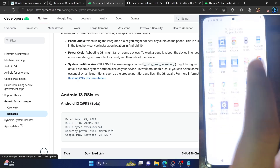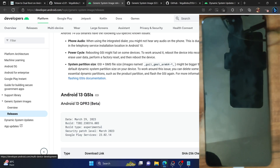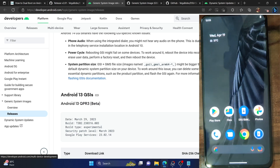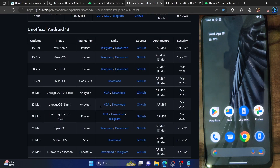This is the system with the latest Android 13. You can even install OTA updates directly from this section — there's no need to go through a separate route. So this is our second GSI ROM. If you want to go back to the stock ROM, just tap Restart and your phone will be back to the base ROM — in our case the Pixel ROM. Both ROMs have separate data partitions: files on the first ROM don't conflict with the second ROM. You can sign in with a different Google ID and have your own Google apps and Play Store apps on the second ROM without conflicting with the first.